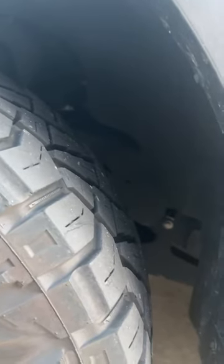You hear that rattle? It doesn't sound good. Ford considers that normal. They replaced my turbos once already — when I first got it, it had about 15,000 miles on it and that rattle started happening. It was a lot worse back then, happening while driving through the neighborhood. They did replace it, but now they're deeming it as normal. It's the wastegates inside the turbos rattling, and there is no fix for it.